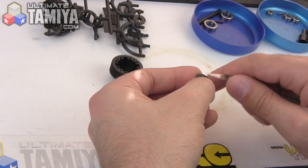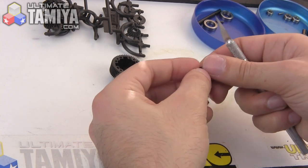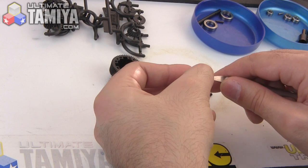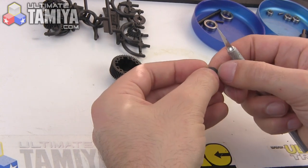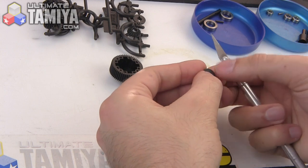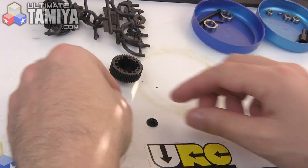The rear is actually going to use a transmission and the gear drive goes directly to the rear wheels, whereas the belt is used to transfer power only to the front differential. What I'm building right here from the beginning is the rear differential that goes into that rear transmission — it's going to be a three-gear transmission, pretty much like you usually see on a two-wheel drive off-road vehicle, a little bit of a departure from the current norm, but Tamiya has done gearbox driven sedans quite a bit in its past.